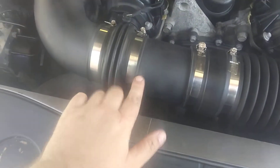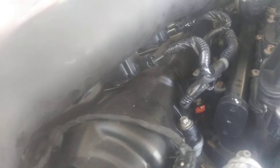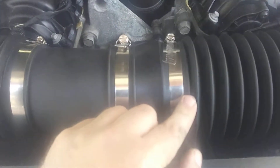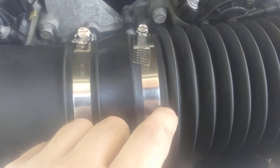So what I did was, we still have the stock air box, the stock bellows. Here's the section I cut out of that cold air intake — I got rid of the flat part, and this is going up to the manifold. I have not started the car yet. The only thing I can foresee happening is it's got really good clearance, except it is sitting on this coil, so I'm going to get some felt tape, just some soft tape, put that on there so it doesn't rub. Otherwise it looks like it fits good, everything's together. This piece and this piece here are going to be epoxied — I haven't done that yet, but I'm going to epoxy this and then put the clamp back on.